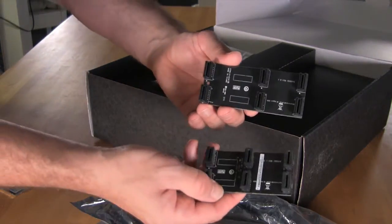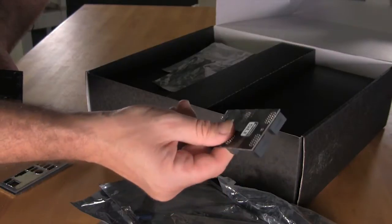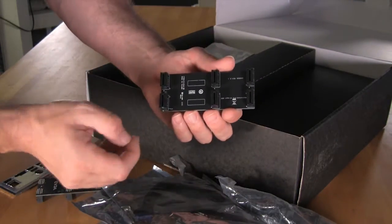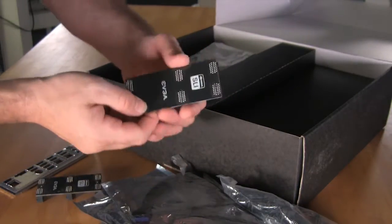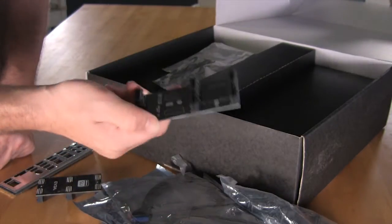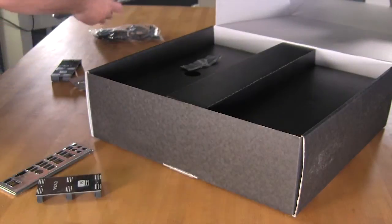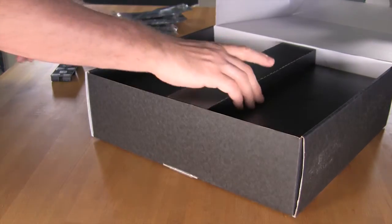You have a flexible and large SLI adapter, and you also have two three-way SLI bridges. The first SLI bridge is for standard use — giving you two cards at X8 and one card at X16. The second one appears to be the type normally used for four-way SLI, but they've left a spot open. Reading the manual that comes with the board, it appears this is for three-way SLI with physics, so you put that card in the center. We do hope to do some testing with three-way SLI this time using both adapters.